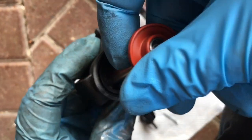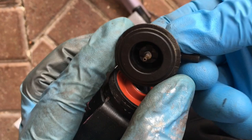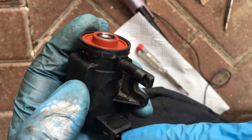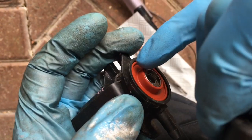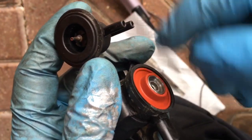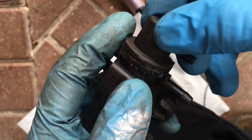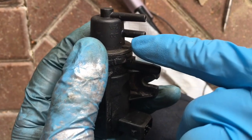Refit your clean filter and refit the solenoid. Here's how this works: vacuum is supplied at one end, pressing against a spring-loaded pad that normally stops the vacuum going further. Once the solenoid is activated, it pulls down, releasing vacuum into an inner chamber where it acts on the diaphragm. Because the other side of the diaphragm is open to atmosphere, it pulls the diaphragm back up, closing off more vacuum. The stronger the solenoid pulls, the more vacuum is allowed in — so it acts like an analog control valve, giving more or less vacuum on the output side depending on solenoid strength.